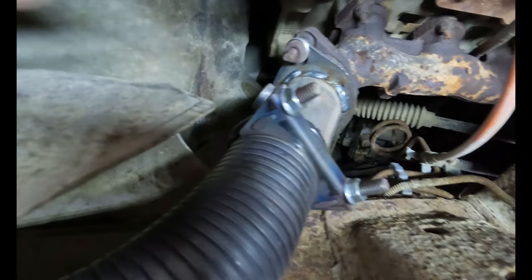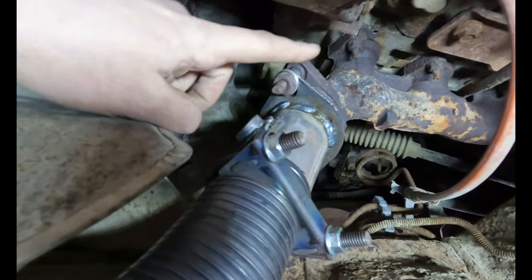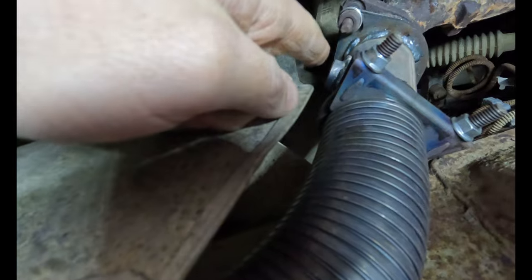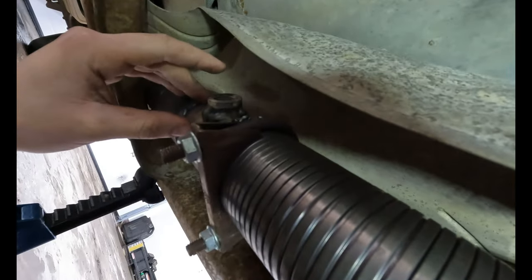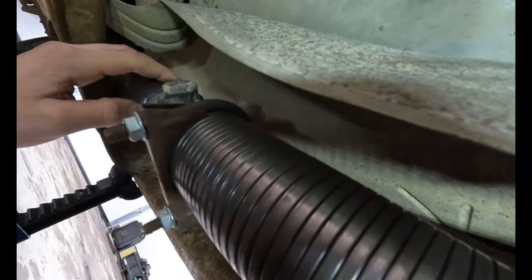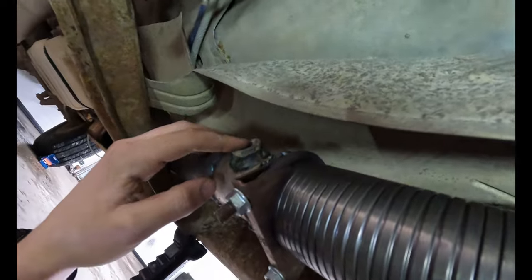In case you're wondering what's going on down here — we got one sensor here at the engine header, O2 sensor. And then typically there'd be a catalytic converter here, which someone stole out of this truck, so that's why it's fancy flex pipe now. And then you'd have another O2 sensor here. So that's just the truck making sure it's not too lean, it's running good, got the right mixture. And this is checking up on that mixture after the cat. I know there's some programs you can plug into OBD2s and delete this one from the software so it's just running off one O2 sensor, which is all the truck needs — this is just for emissions purposes. But we don't have that software; it's like $2,000 to get one of those machines and then another $100 per vehicle you want to mess with. So we'll just eat the 50 extra dollars and plug in a second sensor.